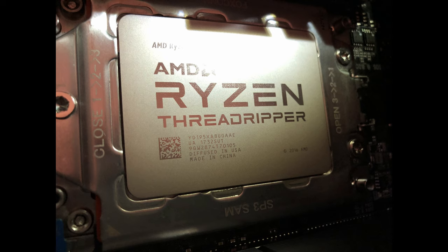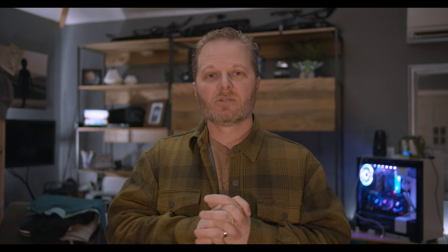The first one is with this Threadripper machine over here. I built it back when Threadripper 1 had just launched, and the Threadripper IHS — the heat spreader — is about that big. When you look at a heat spreader that big, you're looking at cooling a bunch of space. So I didn't want to go with just your standard airflow. I wanted something akin to a custom loop in cooling but that wouldn't take that much maintenance.